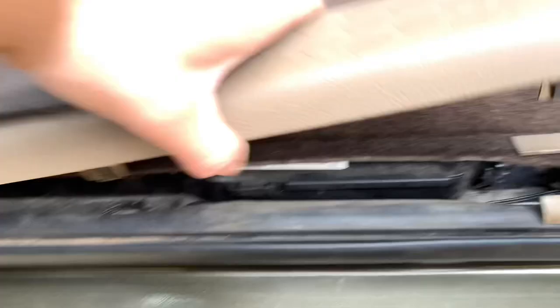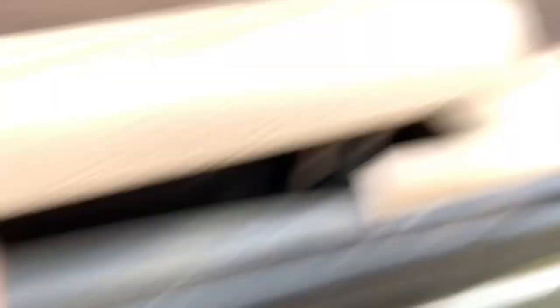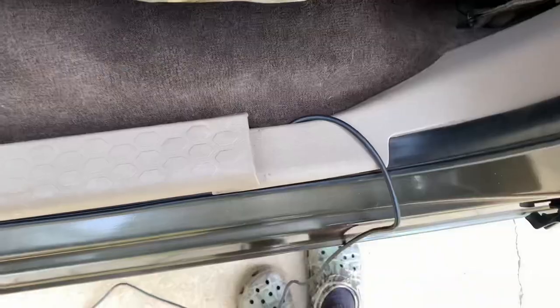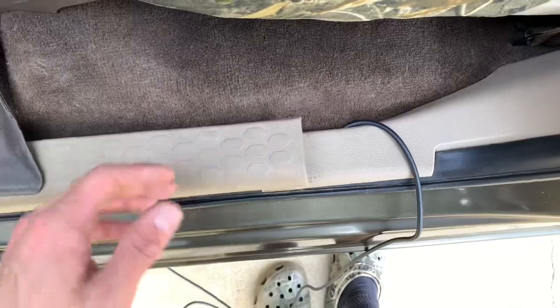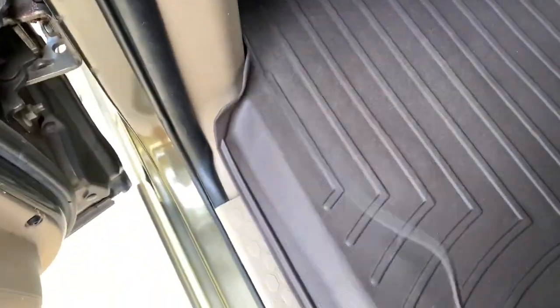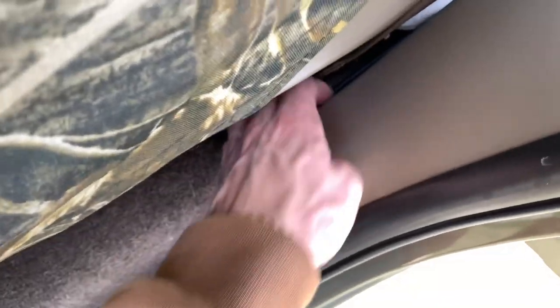Next step: just pull up on this trim piece, pop it out of place where the wires for the seat go, take it, stick your tag in down there underneath it, reach up under here and just pull it on through. When it comes out of the carpet you want to go to your right towards the back of the truck, but push that wire up above the carpet. Go ahead and pop that back in place — pull it through and kind of run your wire so you can get the slack out of it. When you're tucking it under the plastic you're basically just following the wires.